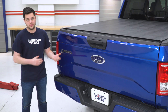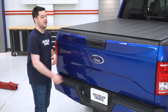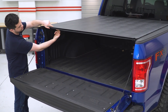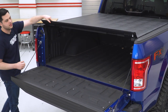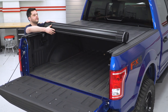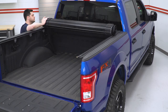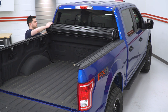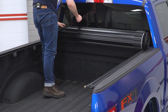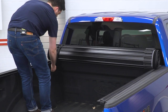I said earlier this can be rolled up and down with some real speed, and I'm going to go through exactly how it's done. First step, we're going to drop the tailgate, then we're going to reach underneath and in order to release this, we're just going to pull on this tab. That pulls the back up and takes it off the tailgate. After that, we're just going to roll this straight up. Then I'm just going to climb in the bed, grab one of these straps, that's just going to go behind the tonneau cover and hook into the bulkhead, then we can pull that tight.